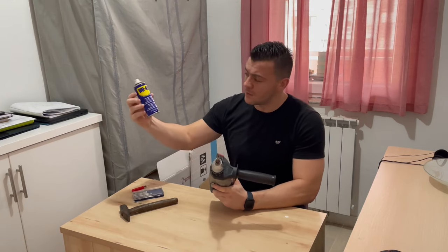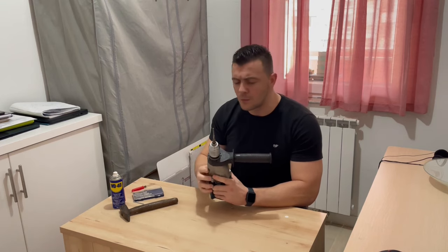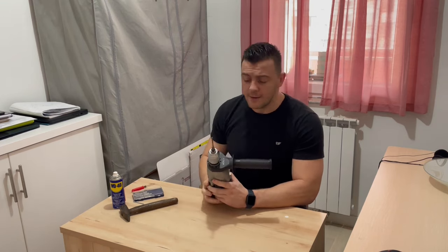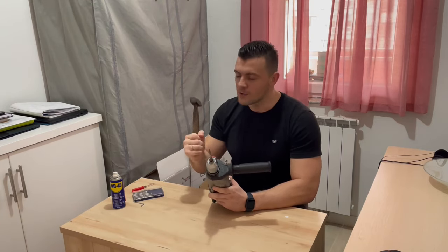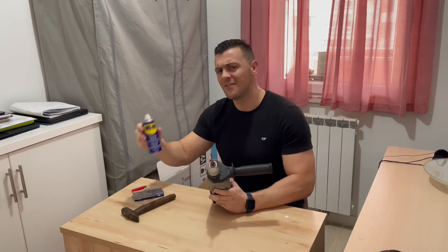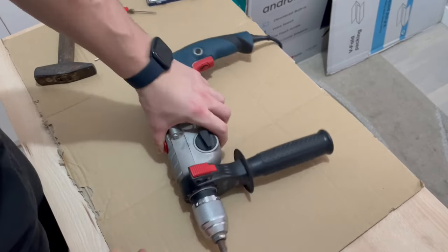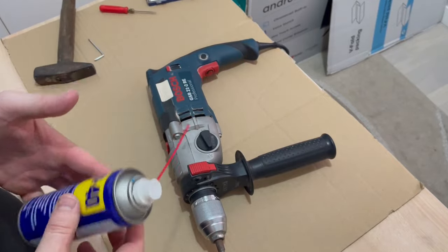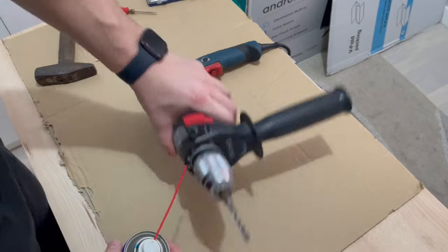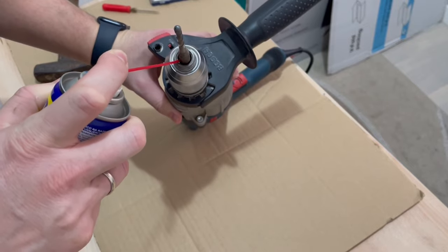It's not working, we need to find another solution. First we will try with good old WD-40 — we'll put a little bit in there all around and wait a couple of minutes. If that doesn't give any results, we will go for some heavier tools. I've put a big piece of board paper right underneath the drill machine because WD-40 when you spray it can leave smudges on the table. So basically take your drill machine and spray WD-40 as much as possible inside the chuck.